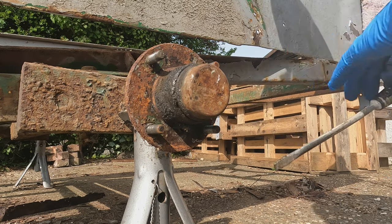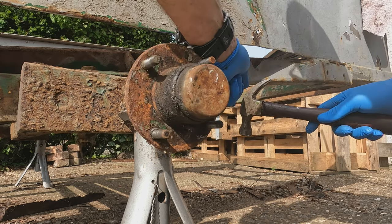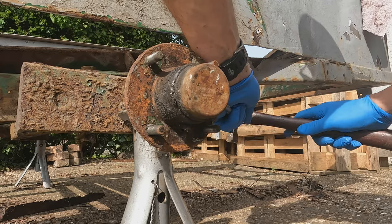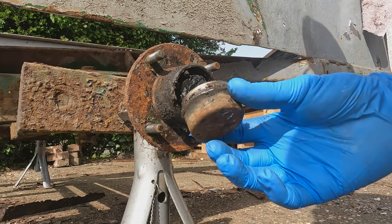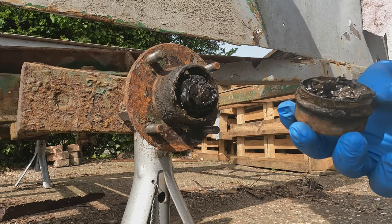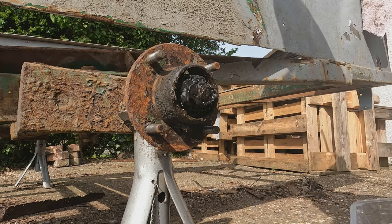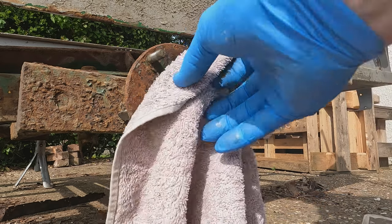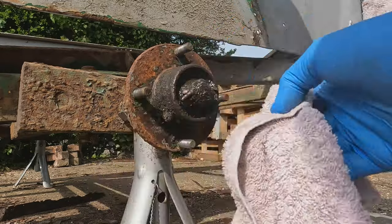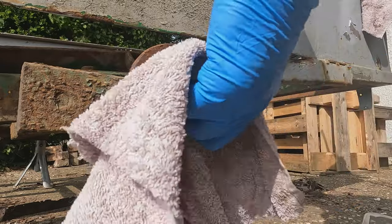The first job is to remove this cap in the middle. Sometimes you'll find this cap's missing and you'll just see the nut, and that's often a problem as well because if that cap's missing the bearing will go dry. There we go, that was easy enough. Look at that — it's absolutely full of grease, but it's the darkest, blackest, mankiest grease in the world. That's going in the tray and we'll get that cleaned up afterwards. Now we're going to clean the end here so we can see what's going on.